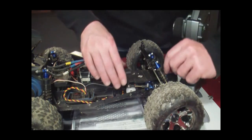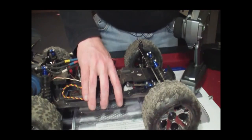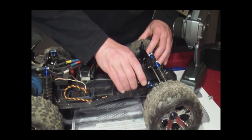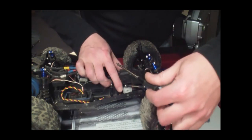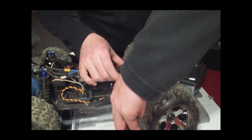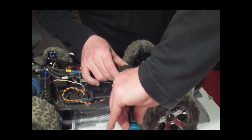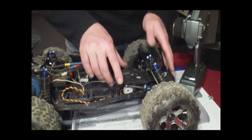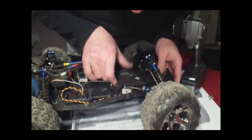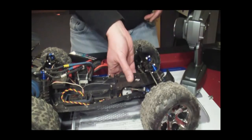Popped off — I'm glad that happened on camera. Shouldn't be testing it like that without the screw. Let's straighten the wheel out again — okay, right about there is where we want it. I'll just tighten it down. Got to love these Hi-Tec servos — didn't even fight me, didn't move the steering a bit while I was turning that screw and cranking it down. The Traxxas servo would have started moaning and groaning. Okay, now the screw's in — let's check it out. Very good.